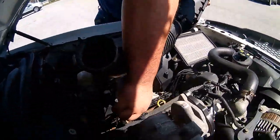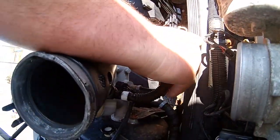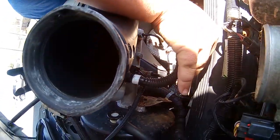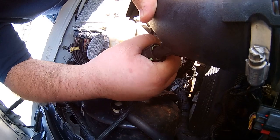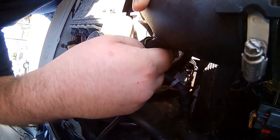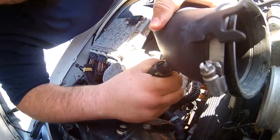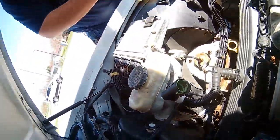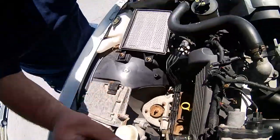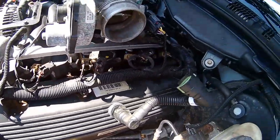He did not break it. And this little PCV hose, sometimes these are pretty bad to get off. There's two of them here. I think you just pull that little clip back, right? Yep, you push it on, pull it back to the side, and it should rock off like it is now. And that's your intake. Quick. So, yep, that's all there is to it.